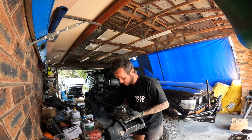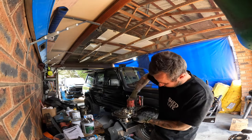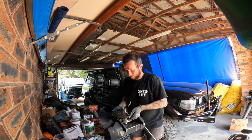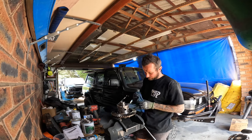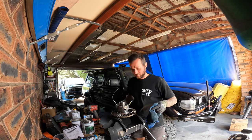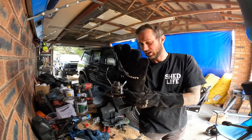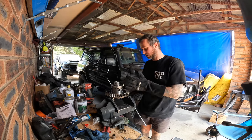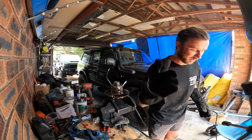Now we flip that and gently rest it there. This bit here is the bit you've got to drill out the side of your housing, but I'll do that once it's all bolted back in. It's pretty tough and durable, which is good. I'm going to grab a bearing with my gloves and test it to see if it sleeves on. If it sleeves straight on, sweet. If it doesn't even look like it's going to fit, I'll go put it back in the oven. That's a no go — back in it goes.